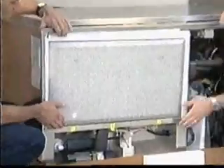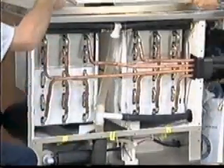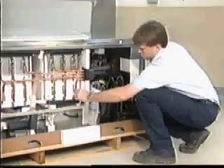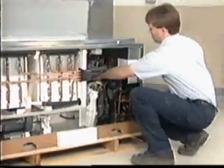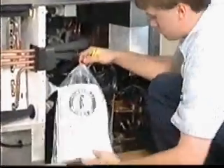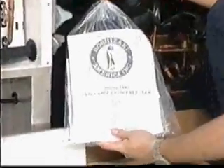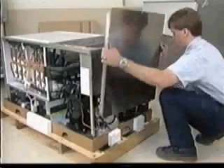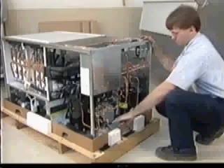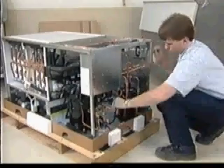Also remove all packing material and tape from inside of the machine, and remove the package containing the installation manual and accessories. Always refer to this manual or your Hoshizaki technician's pocket guide and carefully follow the instructions for installing the ice maker. To prevent damage, remove the outer panels before installing the ice maker.